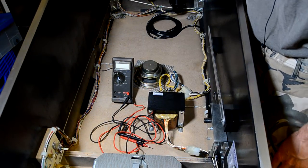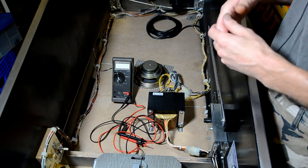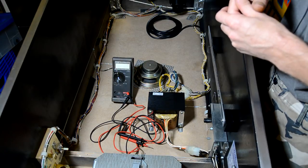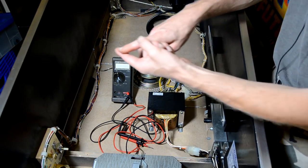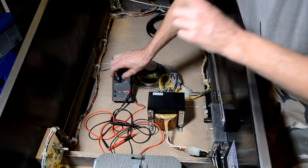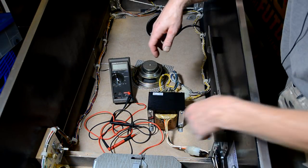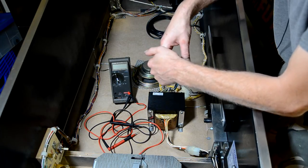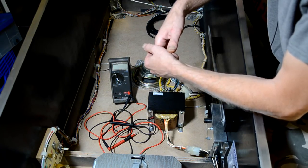You're going to need your multimeter. Before you fire up any pinball machine, you want to check all the fuses. Put your meter on continuity and use the beep test. It's always best to pull at least one tab of the fuse off when checking continuity. You want to check for the rated value of the fuse against what the manual specifies, and also make sure it is a slow blow fuse if it's supposed to be a slow blow, or a fast blow if it's supposed to be a fast blow.